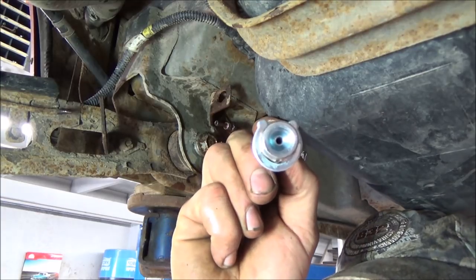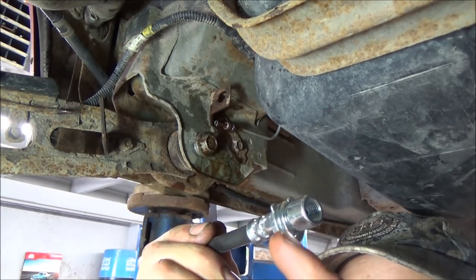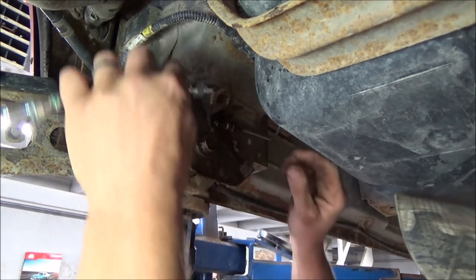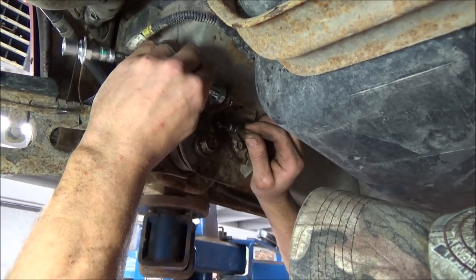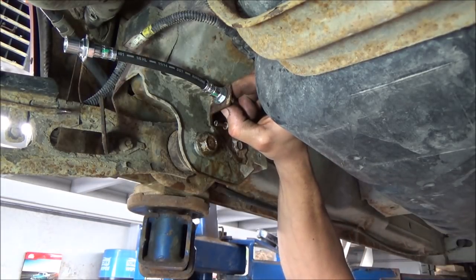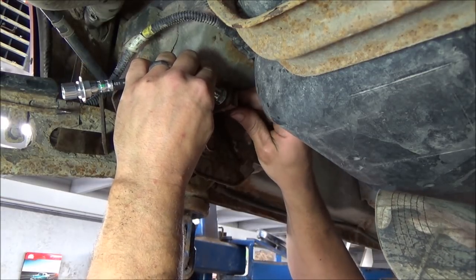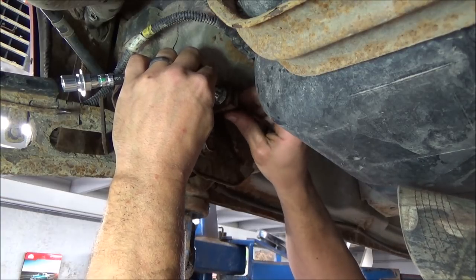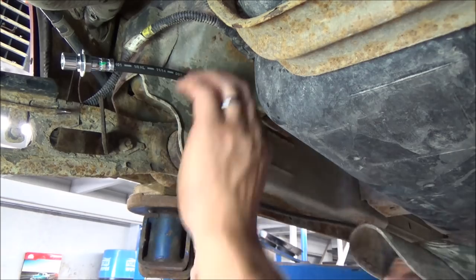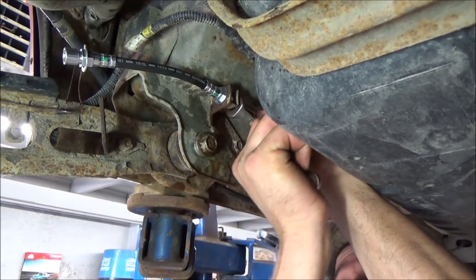I don't know if you guys mess with these much. If you look on the end of the brake hose, it kind of looks like it has flat spots for a wrench, and then on the other side it's kind of half-moon shaped. The hole that it goes into also corresponds on both sides — it keeps the hose from going in there and getting twisted up. You just kind of have to spin it around until it fits. Make sure it goes in all the way, then we're going to put the hose lock on it, then put our brake line back on. That'll aid us in installing the line because it's going to hold the hose for us.